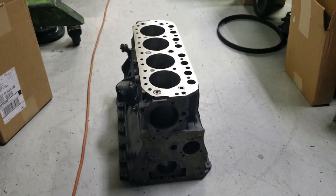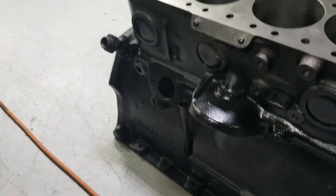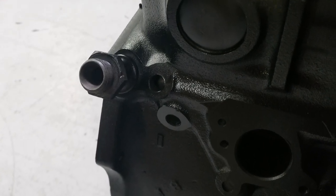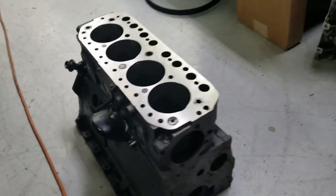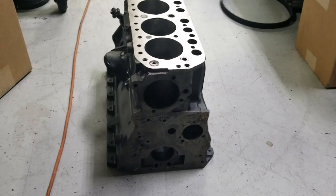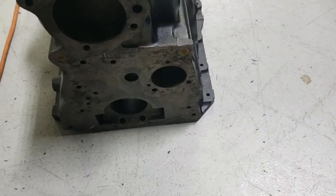That's all been taken care of - it's nice and clean now. When you're getting your engine ready to go into the machine shop - I was just talking with Jeff - he was saying that when you take it in, make sure you strip it down as much as you can. Take all the hardware off, make sure you don't have any fittings on there. On this side there's an oil relief valve on the MGB, so make sure any of that stuff is taken out so nothing gets lost when it's running through on the machine. When they do the thermal cleaning, any plastics, gaskets, rubber sealers or O-rings will get melted.